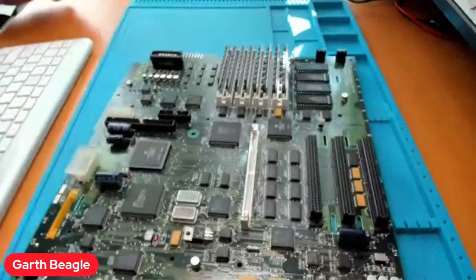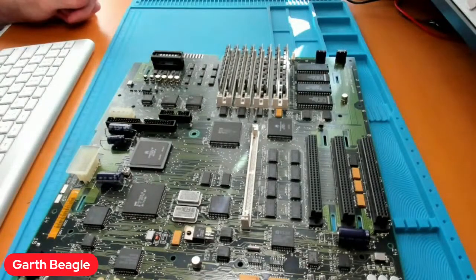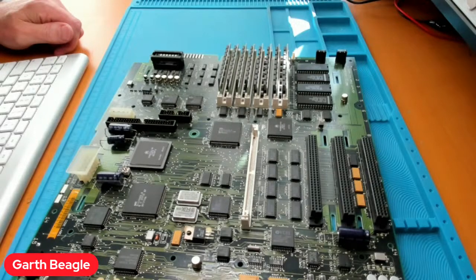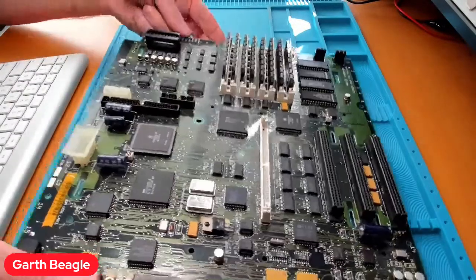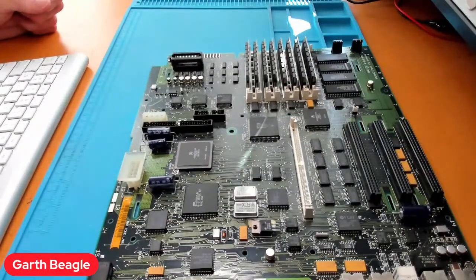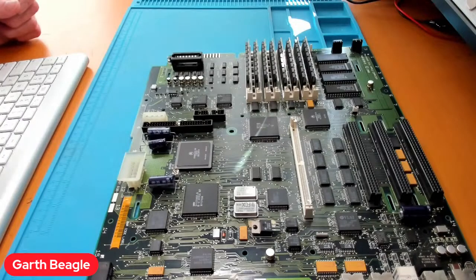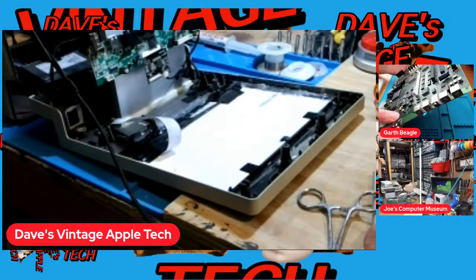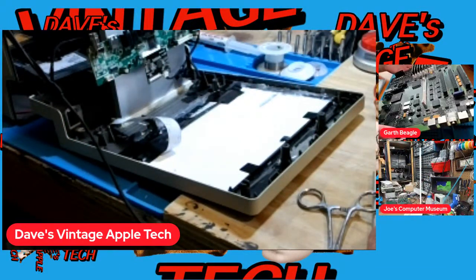I think it's the lighting right now. It's really harsh lighting from the outside coming in, so everything's hard to focus. Yeah, those 4K cameras, they love bandwidth. If you are pumping out all kinds of bandwidth, they're beautiful. But I'm on a 2K camera, and at 720p it kind of doesn't like it as far as the stream. If you do 1080, it's okay, but sometimes it gets a little choppy. If I bump this one up to full 4K, it's hilarious. Again, I'm using this 2012 iMac for processing here with OBS.